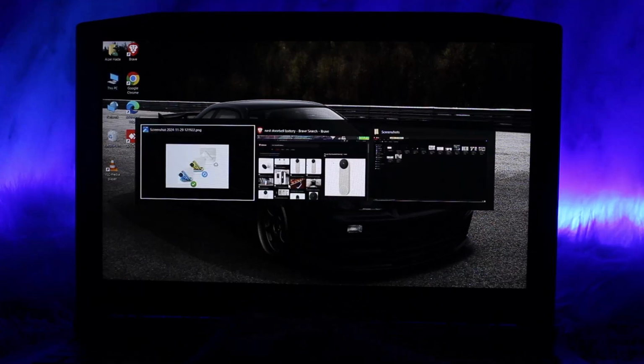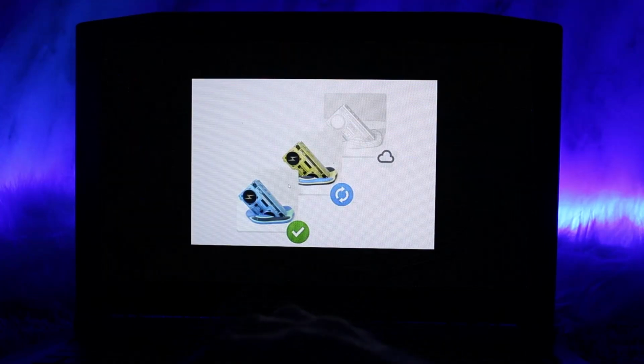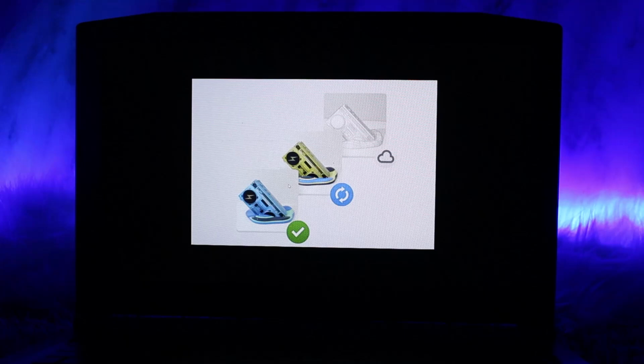Resetting a Google Nest camera can be helpful if you are troubleshooting an issue or preparing to give it away. Before you reset, you need to back up your videos. If you have a Nest Aware subscription, download any important video footage, as it will be erased during the reset. Unlink from your account, which is optional: go to the Google Home app or the Nest app, find the camera, and remove it from your account to ensure it can be set up again later.